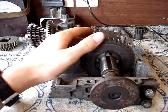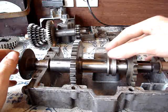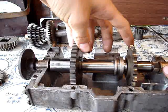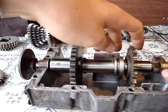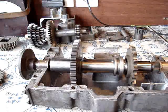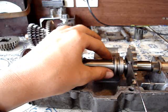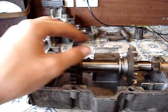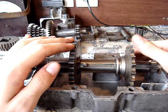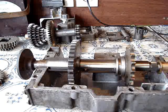So it's now rotating the output shaft. Now for the reverse gear, go back into neutral. Bear in mind these gears are always turning when you lift your foot off the clutch into reverse. There are two little tabs — one on that side and one on the other — that slide underneath this lump on this gear to engage it. So now there's the reverse gear engaged.